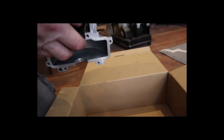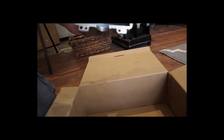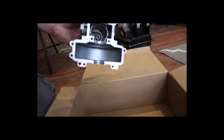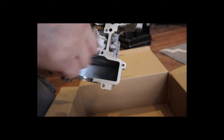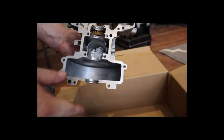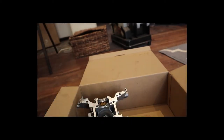We're putting these valves back in — I think it's a GX35. You gently place them down there. Make sure that when you take them out, you take them out one at a time and remember what you have. Any time I know I have parts that can fall through the bottom, I pack it full of paper towels. I'm going to grab a set of my keepers and my valve guides.